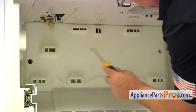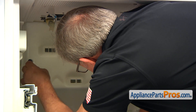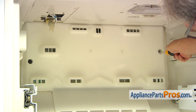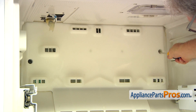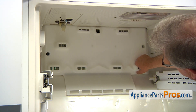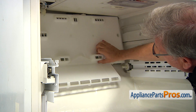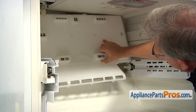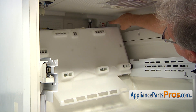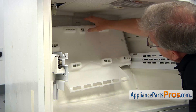Next, we need to remove a couple of Phillips screws that are hidden in those two openings on the sides. I'm going to use a long Phillips screwdriver and remove one at a time. Now I'm going to grab this coil cover and pull it out, putting the evaporator cover slowly down. Then we need to disconnect this plug on the right — I'm going to press the tab on the left side and disconnect the plug. And now I'm going to remove the cover.